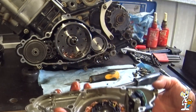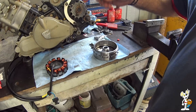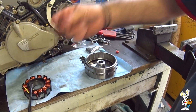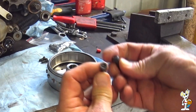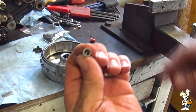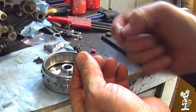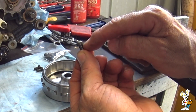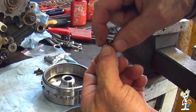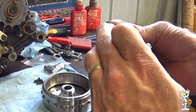You can see the heavy damage there to the stator. I'll pre-assemble with the bolts dry to make sure I've got clearance. You can see the difference in the two bolt heads — the reason I've done that is that the machining for the allen key in the center of the factory ones actually carries down into the shank of the bolt. Looking down inside, it's machined down there and doesn't leave a whole lot of bolt left in the head — I believe they're stretching.